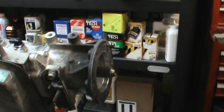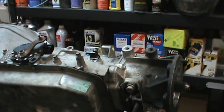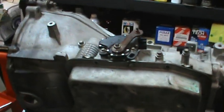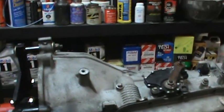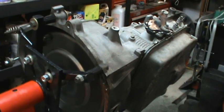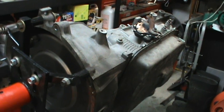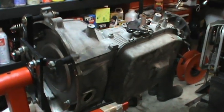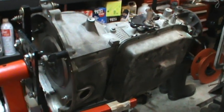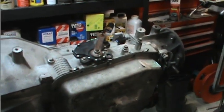That's why the tail shaft looks a little bit different there — the tail shaft housing has a transfer case that attaches to it. I'm not sure how many of those are on the road as far as the all-wheel drive V8s go, but this vehicle was pretty much loaded. It's a 2000 model. This transmission was rebuilt — it's probably been six, seven, maybe eight years ago. It had some other issue; I don't think it was overdrive. So we may find something in there that maybe was not done properly and may have caused the overdrive to fail.